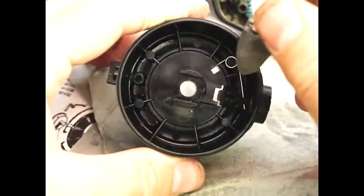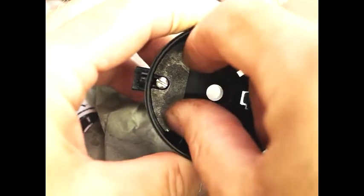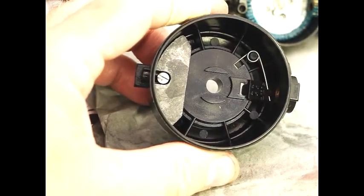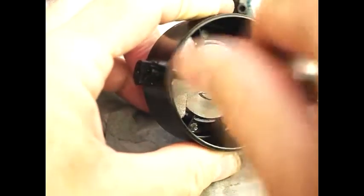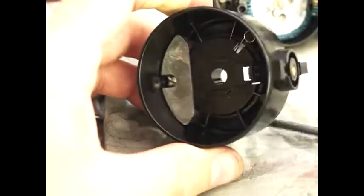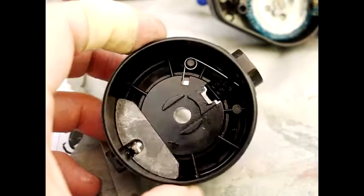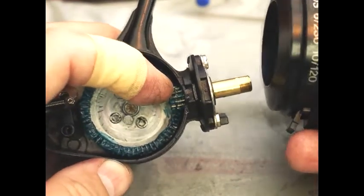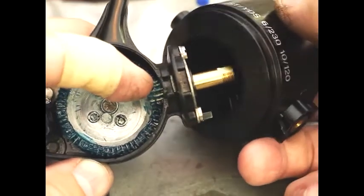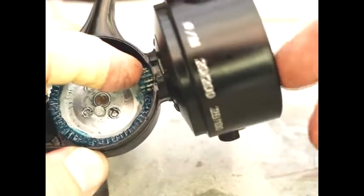And it's essentially a self-tapping screw. It doesn't have a thread because this is a plastic casing. Self-tappers are the best thing to use. You need to find a screwdriver which is narrow enough to go into that little recess, and then you just screw it down, and that's it. It just fits there, and it's a pretty simple affair really. So there you go, that's your counterweight installed. Okay, so that is your drum now fully assembled. So the next part of the assembly is you just put your finger on that little cog there, and you want to push the drum on, and it should run freely and smoothly.